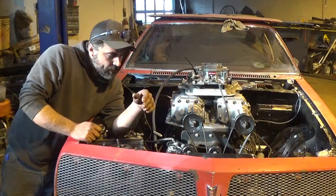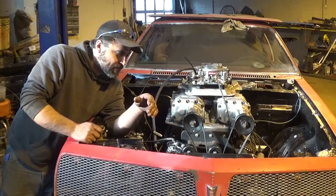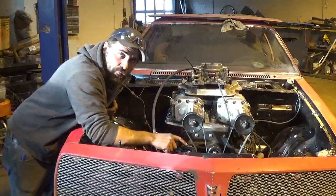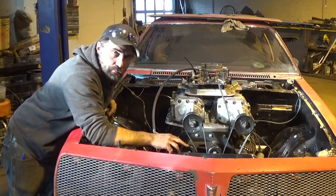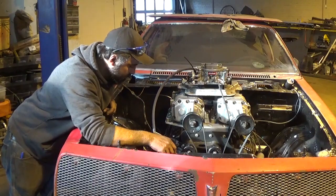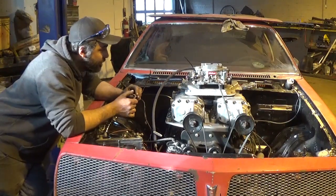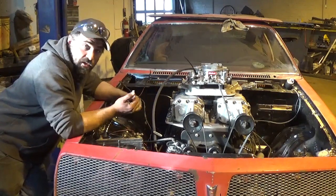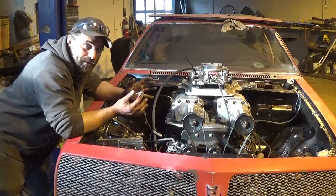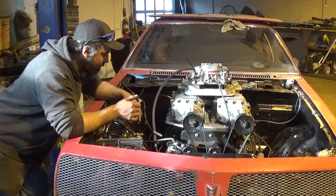The belt thing - yeah, I really should have moved that tensioner, but it pulled six pounds of boost on the gauge. I don't know how much belt slip is actually there - maybe it'd be a lot more, maybe it is slipping. But as tight as this belt is, I personally think I'm either going to get a different pulley over here with some ribs on it to keep the belt from jumping, or I'll just plasma cut a ring out, weld it on there, and it'll keep the belt from hopping when you lift the throttle. But other than that - six pounds of boost we saw today, and I don't think I even hit the four barrel. I am super stoked. The whole car rocks like crazy and it seems to run really good with no tuning on it whatsoever.